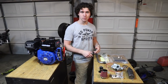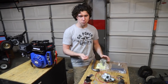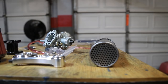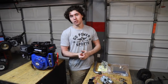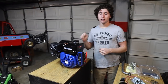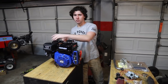Here's what we're going to do to make it kick a little bit harder. We have a hot 265 cam and then a supporting mod to make sure we don't blow up our engine — an ARC billet rod as usual. We're running a Mikuni carb with an air filter, a top plate, and an RLV muffler. Pretty straightforward build. Since it's never been run, we don't have to worry about draining fluid, so let's start by taking off the gas tank, air filter, and exhaust.